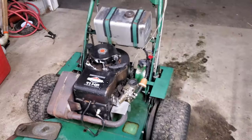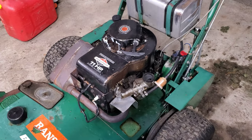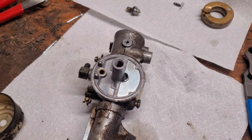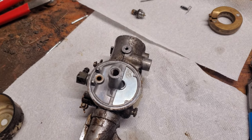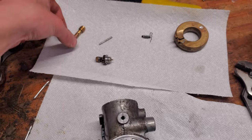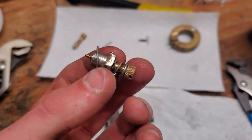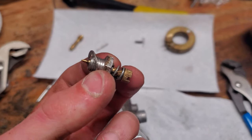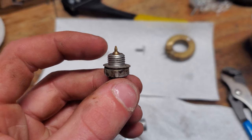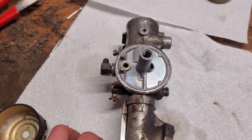This thing didn't run. It got a sputter on starting fluid, so I'm going to pull the carb off and try a carb clean. I got the carb off and cleaned everything out - it didn't seem too dirty, just a little bit of dirt and nothing looked clogged. There's an adjustment screw on the bottom that I accidentally messed with, so I'm going to have to look up the stock setting for that, since it controls how much fuel gets into the engine.